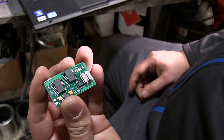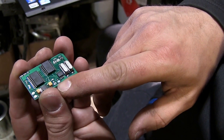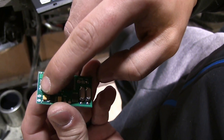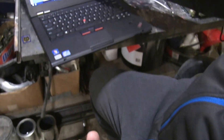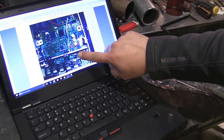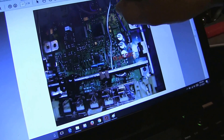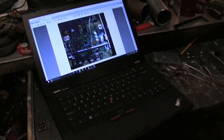Our next step is to install the CR1 emulator. We'll be soldering wires to the CAN high and CAN low, and then to the plus 12 volt and the ground over here on the side — so we have those four connection points. Per our diagram, the CAN high and low will go on the bottom side of the ECM, the ground will go to this leg here, and the plus will go to a 12 volt source up on top of the board.